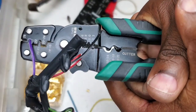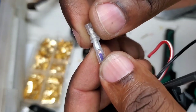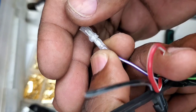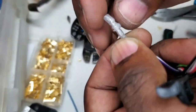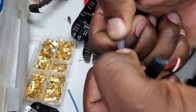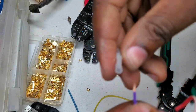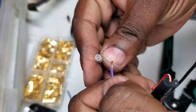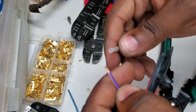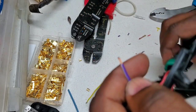We're at maximum. Looks like it did not break the insulation, but let's see how strong it is. Pretty strong — but actually it failed. I can just pull that apart with my hand. If I can pull it apart with my hand, that crimp was not successful, so this one won't go to the next round.